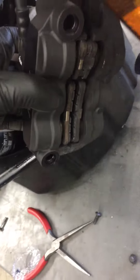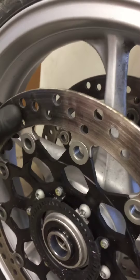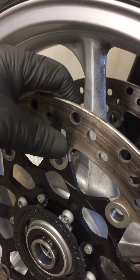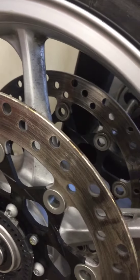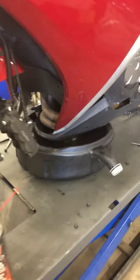I am suggesting new pads for you because of that uneven wear. I looked at the discs — the new tire is already on for you — and the discs are in great condition, not grooved or anything unusual. I'm not 100% sure how long you've had those brake pads in there, but they look original and they probably are original.